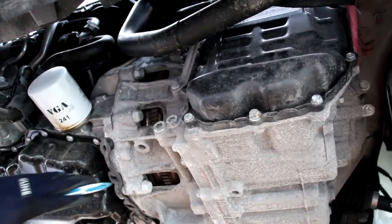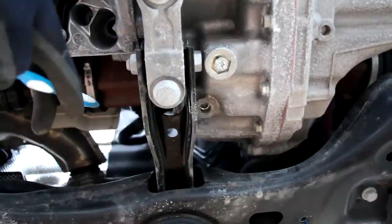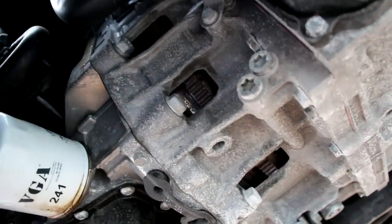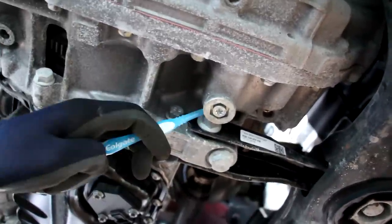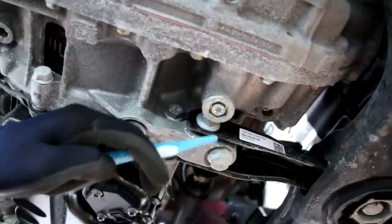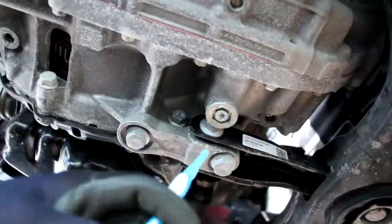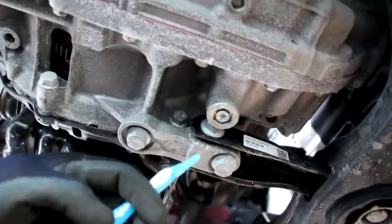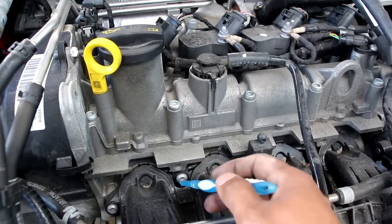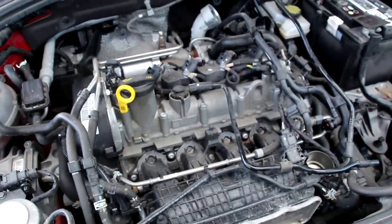The transmission is going to connect to the engine, then go over to a counter shaft over to the differential at the back. The differential housing is then going to send power to the wheels through these CV axles on either side. Now one thing I noticed is how open the flex plate and torque converter is — you can see right through these vent holes the teeth for the starter motor. Underneath the transmission we have a drain port but it's also a fill port. When you want to change transmission fluid you're going to unscrew this outside part here — the whole plug is going to come out with all of the transmission fluid. Then you're going to screw back in just the outside piece and that's going to leave a hole in the middle. Inside the transmission there's a straw; you need a special machine to hook up to pump fluid up inside of the transmission until the straw fills over and it starts dripping back out. That's a lot more complicated than just a fill port at the top of the transmission using gravity to bring it in. Now one thing I noticed is that Volkswagen likes to use a lot of torx and triple square or 12-point style sockets — it's just something that they normally do and you're going to have to buy a new tool set if you're not used to working on German cars.